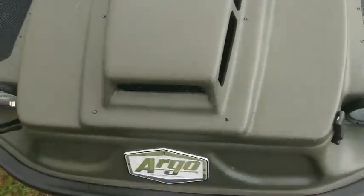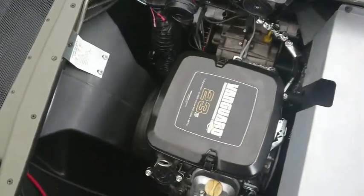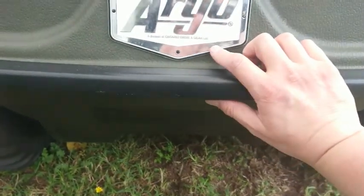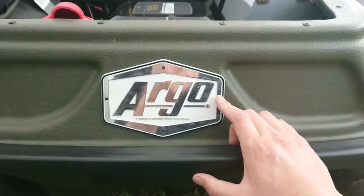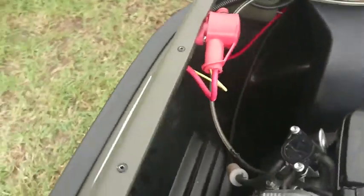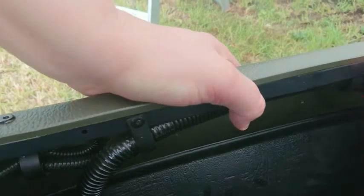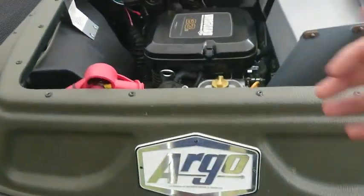When I originally looked at buying one of these, I saw how a lot of the winches were mounted. And they're all mounted on the front here. And I thought hiding behind this badge might be three pre-drilled or pre-threaded winch mounting holes. In reality, there isn't. If we go around and look at the other side here, there's nothing. So, I don't think I can just whack three bolts through that and hook a winch on there, because I think I'll probably rip them out. I probably need to come up with a doubler plate on the other side.